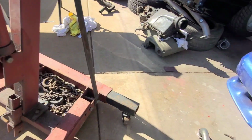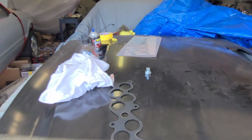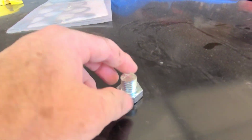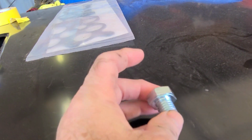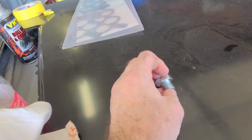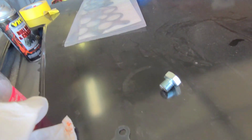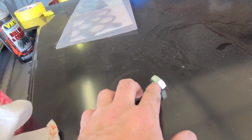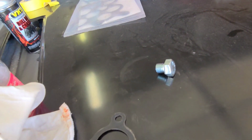Like I said, I went through my stash. Got another set over here that's in good shape. And here's the other half of that bolt. Like I said, it's in about an inch, half inch or something like that. But this will give you basically two sets you can use. You can use this on another set of heads. So you could even cut it down here on the head, and that way you don't have the head of the bolt showing out of the back of the block.